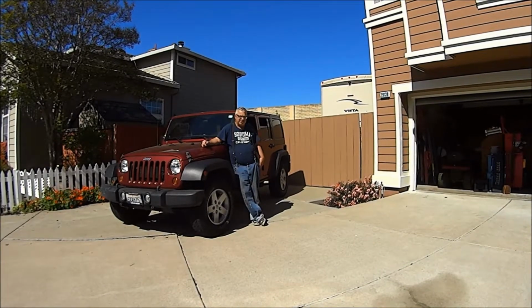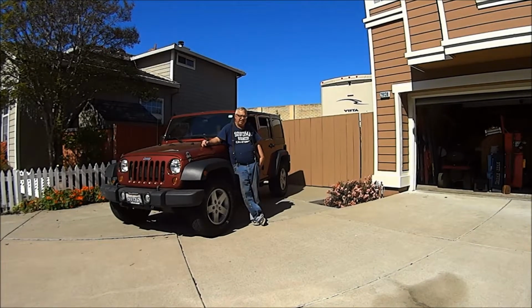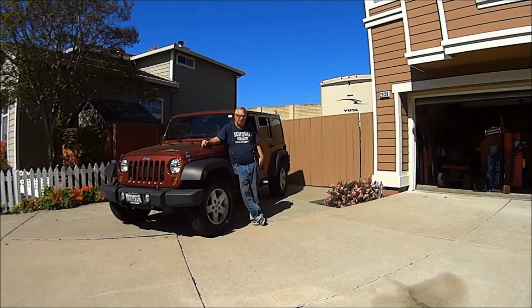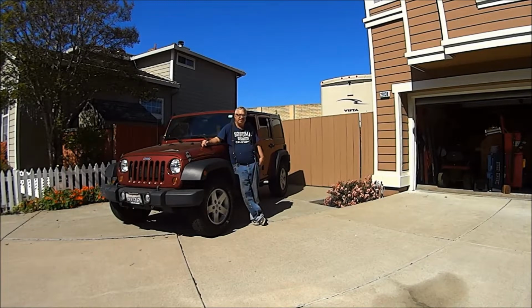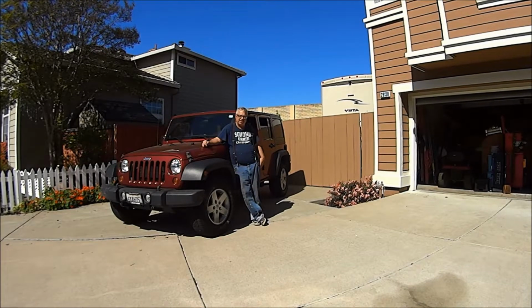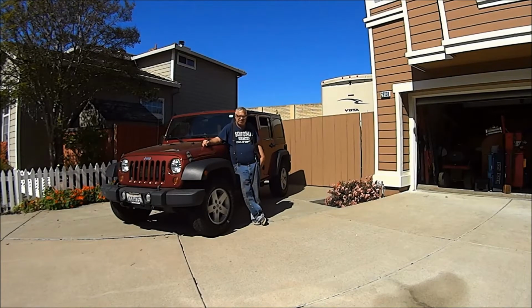And I find that curious. I've been working on cars all my life, and every vehicle I've ever worked on, even the old ones that had four-wheel drum, the front brakes always do most of the work, so they wear faster. But this vehicle, the dealer says it wears faster on the rear. I did a brake check some time ago. He's right, they do. Why that would be true is beyond me, unless the front brakes aren't doing their job. But the thing stops pretty good, never had any trouble in that regard.